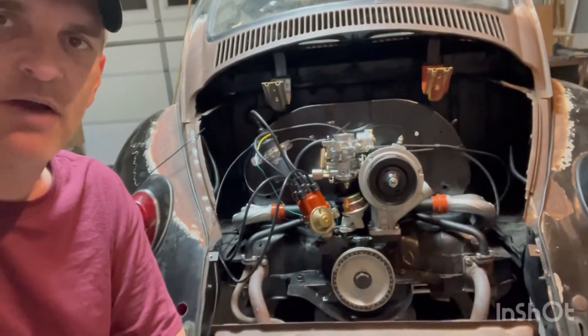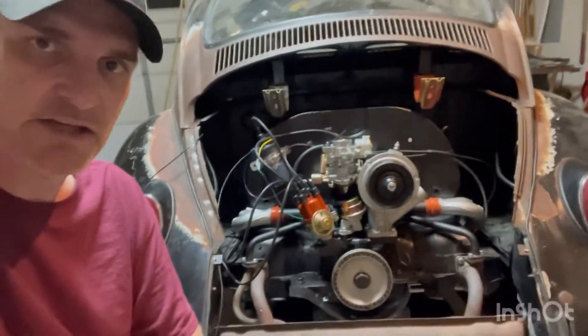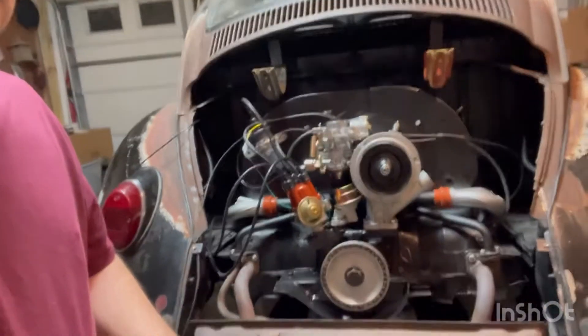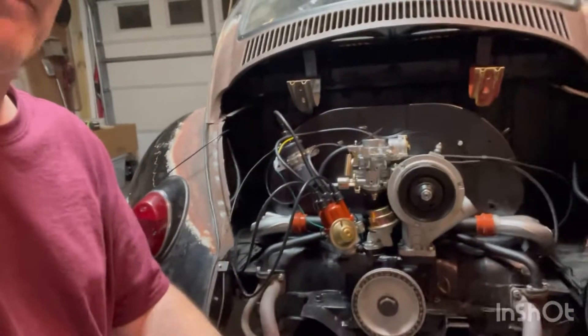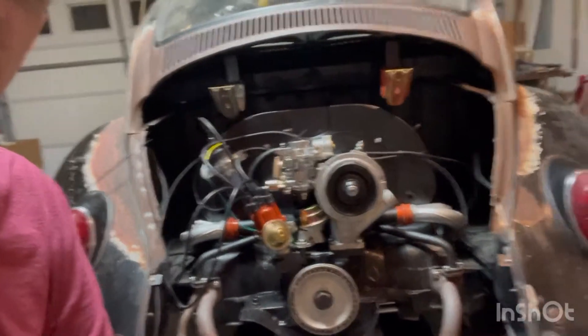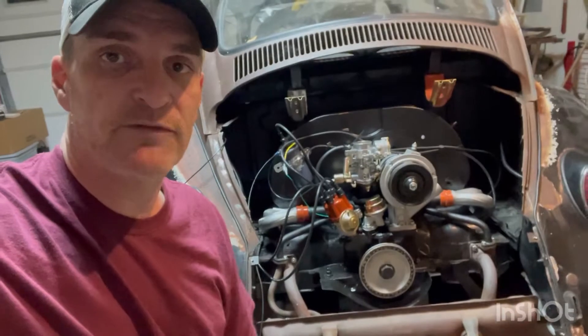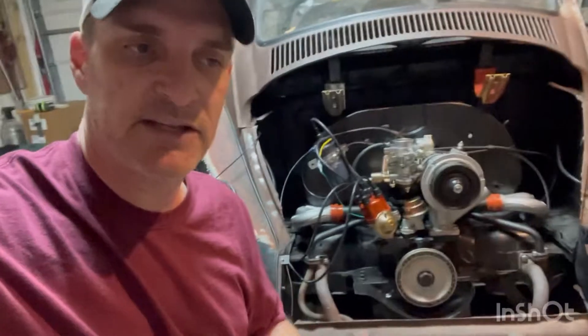So I re-pulled the engine and the next thing was to check the bushing in the starter. This is a swing axle, so it has — I think it's a 5/8 hole — for that bushing to fit in, and the bushing walls are thicker on a swing axle transmission compared to an independent rear suspension transaxle. The hole is different, so the bushing is going to be thicker when you're going with a 12 volt starter versus a 6 volt starter. The bushing was perfect, so I pulled the starter back off, laid it on the floor, and tested it — you could tell it just didn't have the juice.